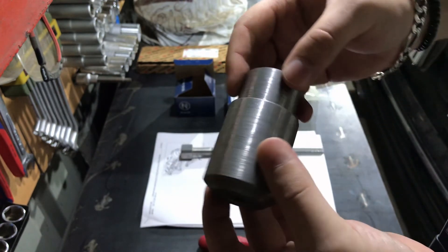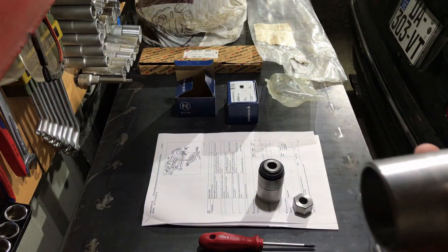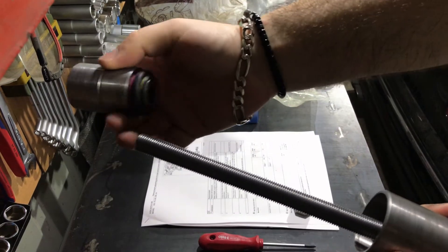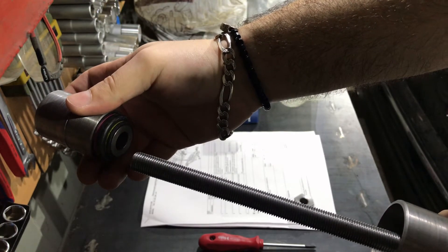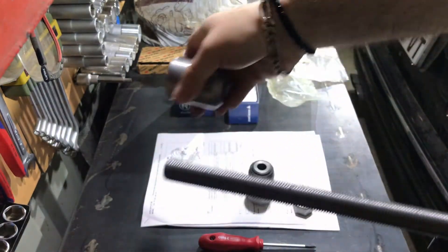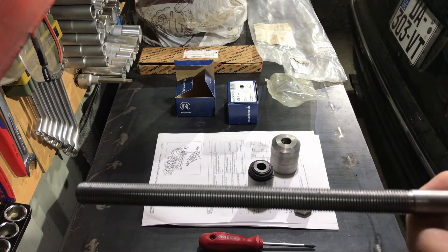The bushing is pulled into the wider tubing on the opposite side of the knuckle, and I am able to screw the fastener bolt and then press the trailing arm bushing into the knuckle itself. Now I am showing you the correct way of installing this trailing arm bushing.